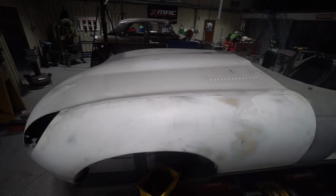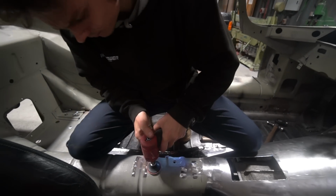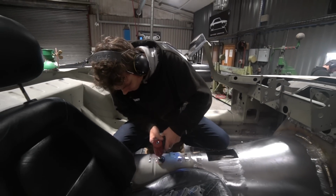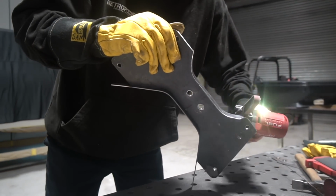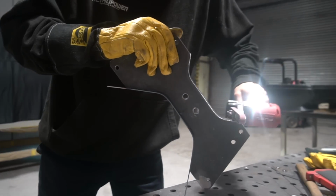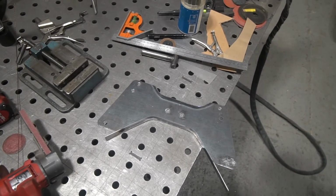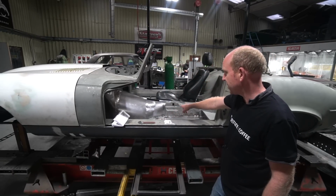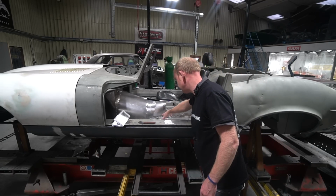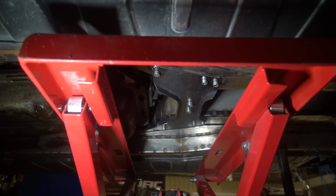Sam's actually made the cross member for the front, made the brackets for the back. He's not pocketed the transmission tunnel yet, just in case there's a change in terms of the dimensions and where that's got to fit. The other thing he's done this week is make the transmission cross member. I think he'd started that at the tail end of last week. He's finished that transmission cross member, made the mounting plates that go onto the transmission tunnel, and got all that bolted in place, and then brazed in these counter plates with the welded-on threaded bosses in. Those were TIG brazed onto the floor, and as I say, the seat box will then cover the bulk of that part once that's fitted, and then it means that the transmission mountings are effectively hanging on the inner end of the seat box, supported by the transmission tunnel and the end of the seat box. It's a pretty strong structure, really. It's quite nicely laid out.